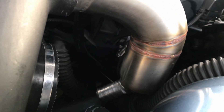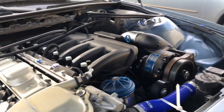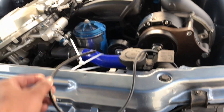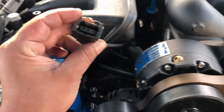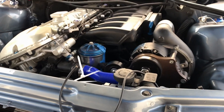That's a lot of progress — this piece right here has been a lot of work, definitely worth it. The time put in was a lot and it came out really great. Basically we've got to get it all hooked up now — get the clamp and hose on, finish up with the exhaust, and we're ready to get this thing tuned and start it up on boost. A couple little things to finish up: hooking this up to the manifold, a couple of vacuum lines I've got to get rerouted and extended, and extending the MAF sensor — it's going to go a little bit farther down so we need to extend it a few inches. A few more things and we're almost ready to roll.